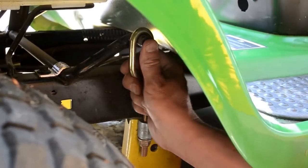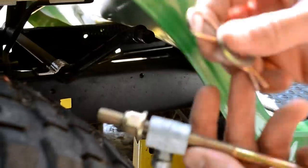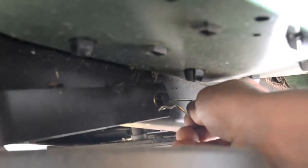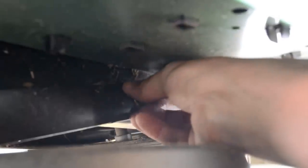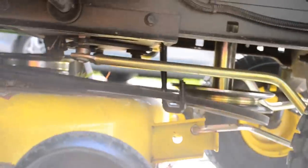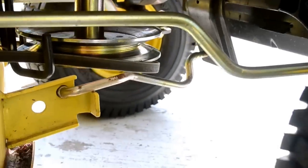Same thing on the other side — just repeat those steps. On the back right side, starting with that cotter pin on top: pull up, lift up, and slide that thing off. The bolt will slide 90 degrees and you can pull it out — just put it where you'll remember how to put it back in. The second one on the right side is that flat iron bar. Pull that cotter pin out — there should be a little tiny washer on there. Pull that bar off and it'll just fall down. You can see the whole deck kind of slid at that point — just that little gold bar in the front and we're good.